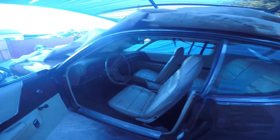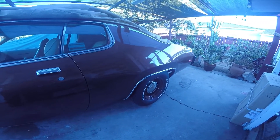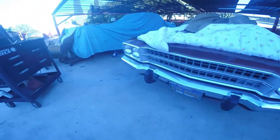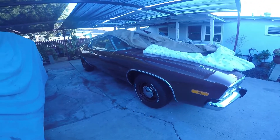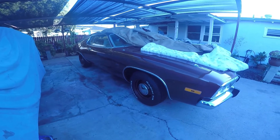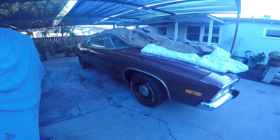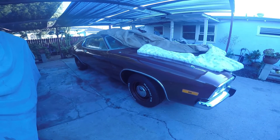It'll be a nice cruiser. I put new shocks front and back and changed the springs — the original springs were sagging a little bit. I had a set of e-body springs that fit fine. For the fronts, I just changed the shocks to a Gasmatic gas-charged shock. As always, thanks for watching — if you like this video, comment, like, share, and subscribe.